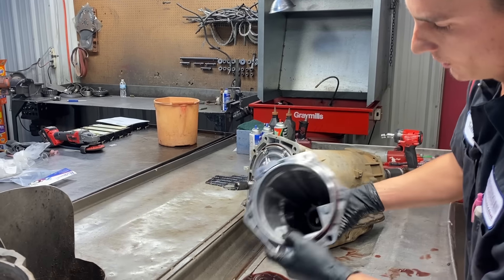So here we just want to look at our pump body - we've got a 13 vane. What I mean by that is these are called vanes and there's 13 of them. Everything looks really good. We'll go in there and scotch brite that. It looks like there's damage but it's just a shadow - that's all we're seeing. Same thing on this - it's just a shadow, we'll rub some scotch brite on that and get a nice brand new surface ready to go. New pump gears, new kit - we've got everything right here. These are beautiful kits, comes with everything. You just want to make sure you don't have any dents. It's just good to check things - we check everything. You never know how they're handled through the manufacturers.